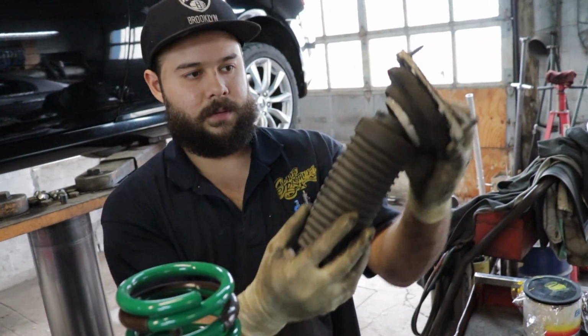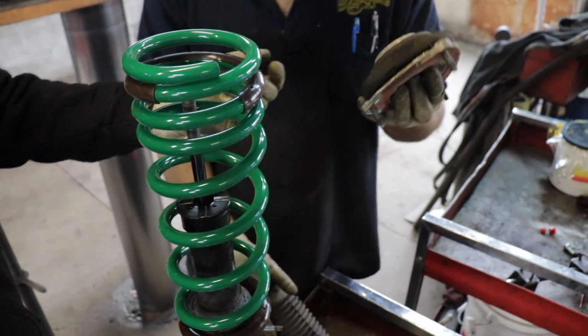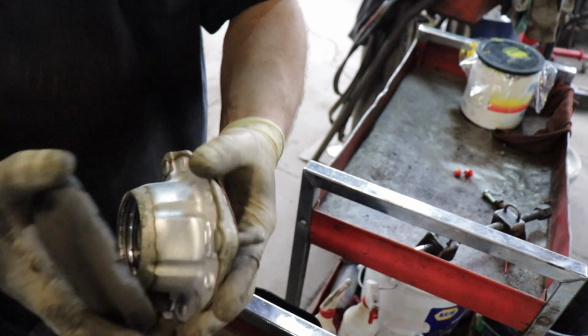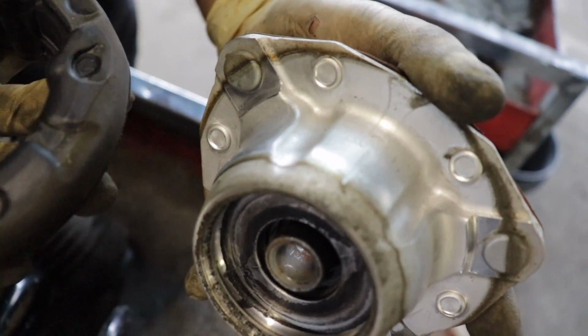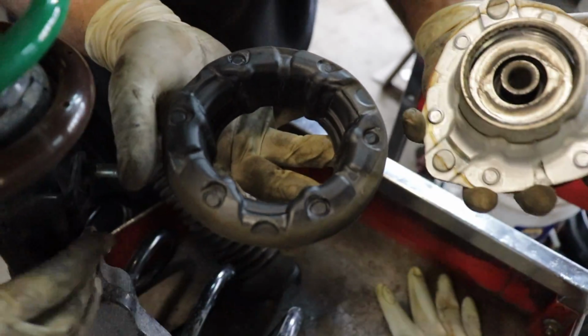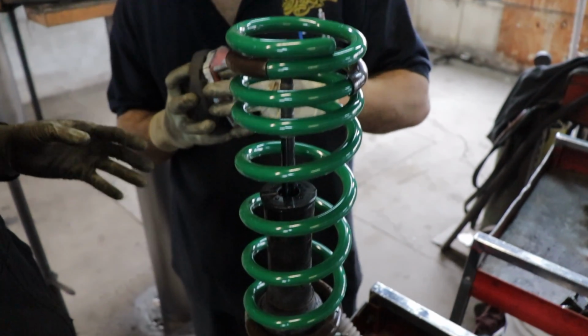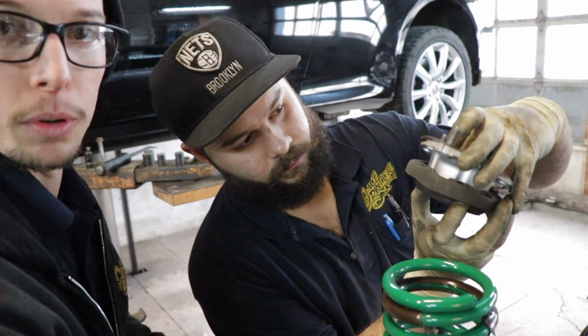So you gotta pull it out of the car. We had to pull the bottom off, and this has little grooves, pull it apart, that it sits in on the mount. See these grooves here? And so then we can turn it so that the actual mount will sit up in the car correctly. Because if we assembled it the same way we did before, it wouldn't go in, and then we'd have a bunch of issues and have to pull back out and pull it apart.